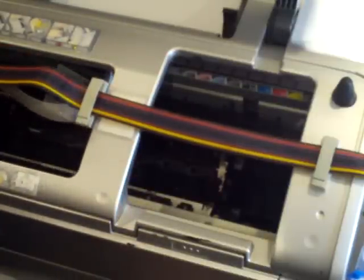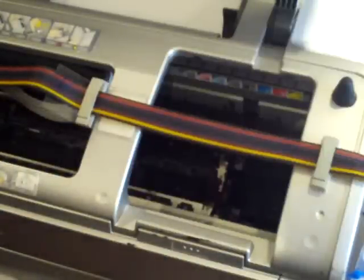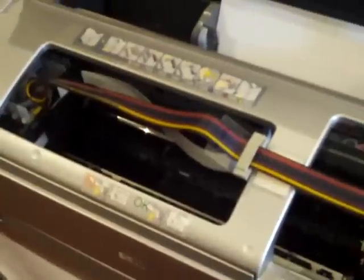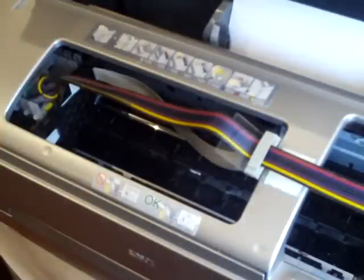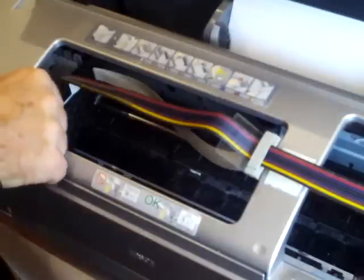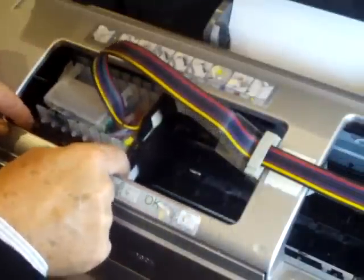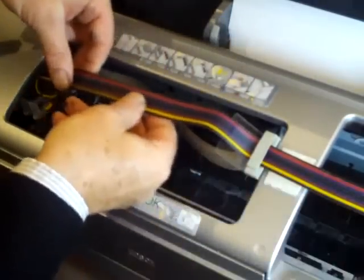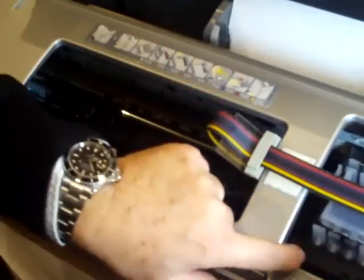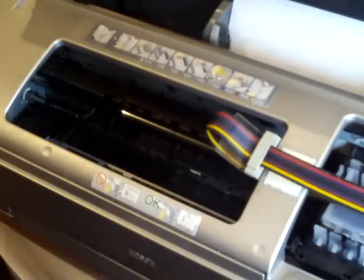We make sure we've got a reasonable tension and adjust that slightly until we've got a nice tension. Moving our view to the other side of the printer, you'll actually be able to see the carriage as it moves across. That's the ink change position — as you can see it comes across and makes a nice arch. It can go all the way to the back; it's reasonably tight but not too tight. We adjust it slightly until it reliably gives us this arch, and once we achieve this we're quite safe to turn the printer on.